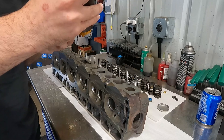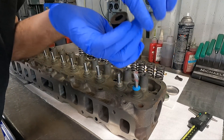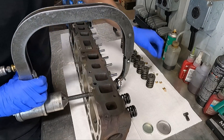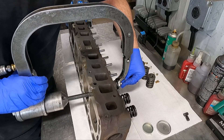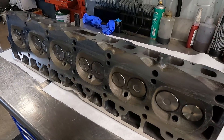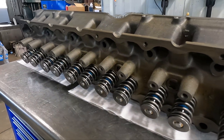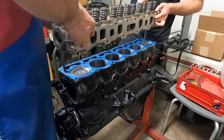Finally, we're ready to move on to the assembly of the head. We're installing valves with a bit of assembly lube on the valve stems. These are SBI valves, Engine Pro valve springs, and we're reusing the spring retainers but with new Pioneer valve keepers as well as the positive Viton valve stem seals that we cut the guides for earlier in the video. While I was working on getting the head wrapped up, Dad was over in the assembly area getting the short block assembled so that as soon as the head was ready, we could get it set into place.